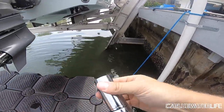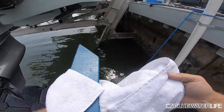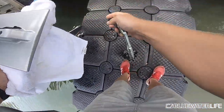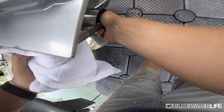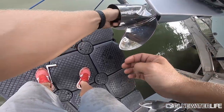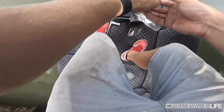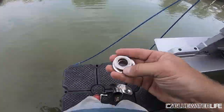To remove the prop, all you're going to need is a socket with a 1-and-1/16-inch bolt. I also have a piece of 2x4 wrapped in a towel so it wouldn't scratch — that'll help whenever you torque the propeller to prevent it from twisting on you. Once you get it off, there's a bolt and three washers — make sure you keep those in order and don't lose any of the washers.